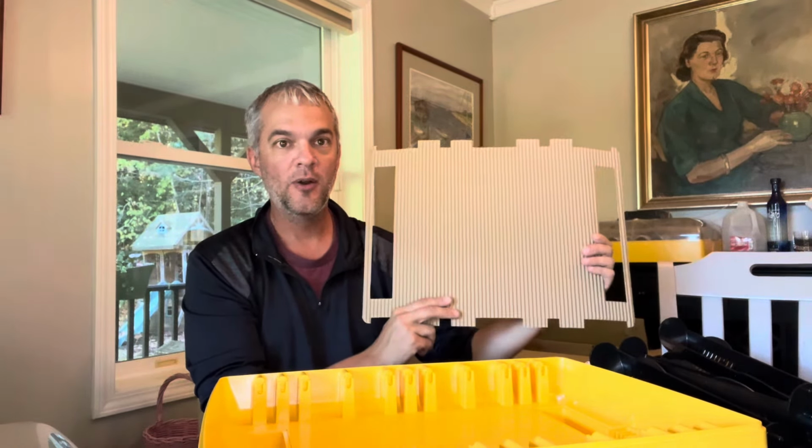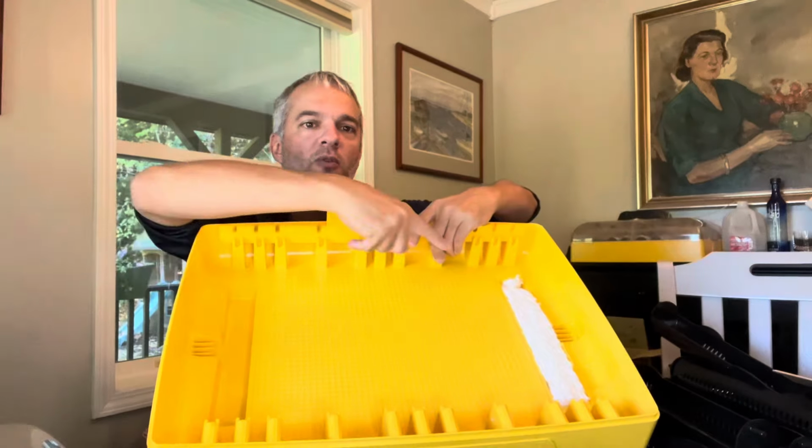So to set this up, we'll do the pump, which is the most difficult piece, in just a second. The easiest part is this. First, this is the evaporation pad, and there's two different ports down inside. You can see there's one over here and one over here. Only one of these gets filled with one of these evaporation pads, and it's the one that is actually going to take the water. If you are looking at this with the turner towards the back, it'll be the one on the right.